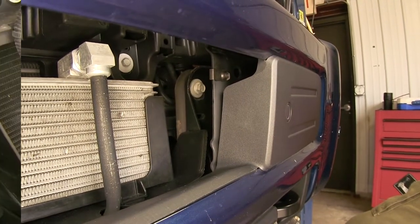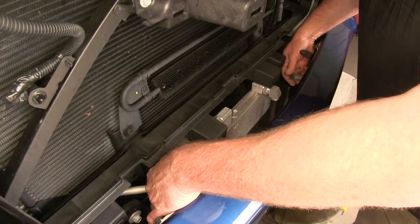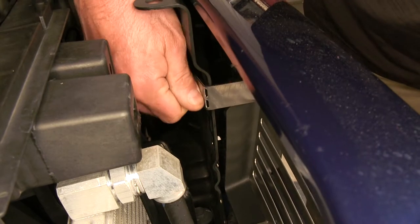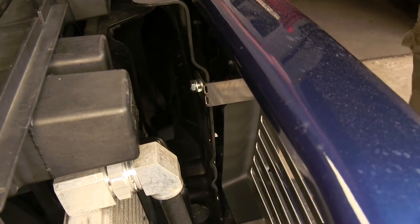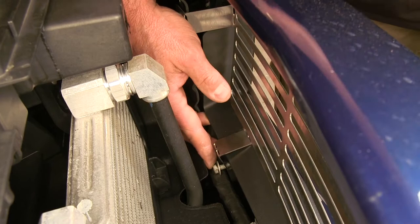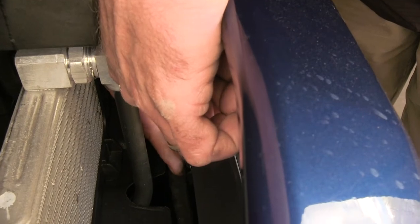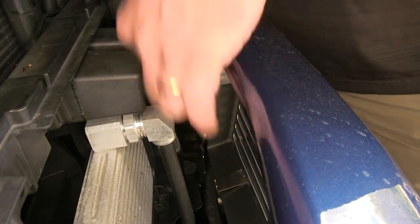Now we can take our grill and gently slide it down behind the bumper, lining it up with our holes. We'll take the quarter inch bolt and lock washer that came with our kit and put it into the clip we installed on the back side of the bumper. Start these hand tight until we get them all started, then reinstall the ones that came out of the bottom side as well. You might have to push a little pressure one way or the other to get the bolt into place. Repeat this for the other side. Now tighten up the two 10 millimeter bolts on the bottom side, then tighten the two bolts from the kit using a seven sixteenths socket.